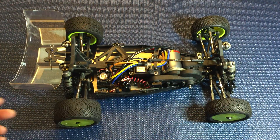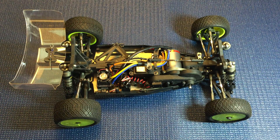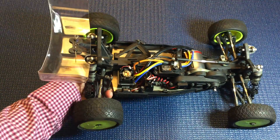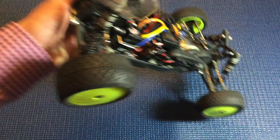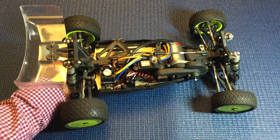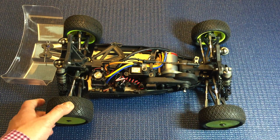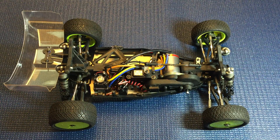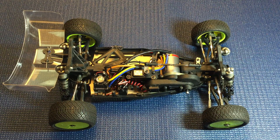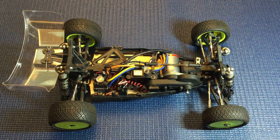One other quick thing about the one-way clicker — what it does is basically make it act as sort of semi-two-wheel drive when braking. It allows the front to spin faster than the rear under braking, or anytime the front wheels are going faster than the motor. It's adjustable — you can dial in as much or as little effect as you want. Most people won't like it because on high-traction surfaces, four-wheel drive is going to perform better and you can brake harder later. But landing-wise it does help smooth things out, and it's tunable, which is pretty unusual for this type of vehicle.